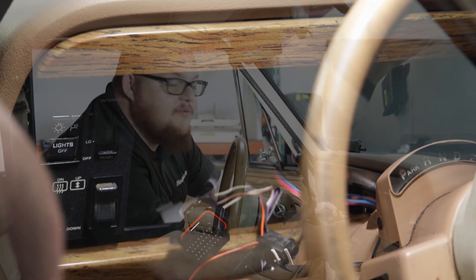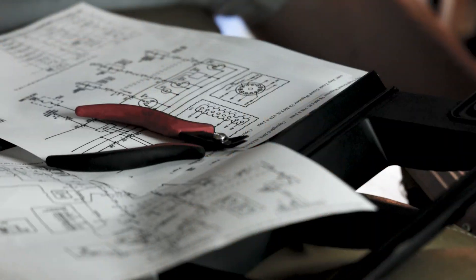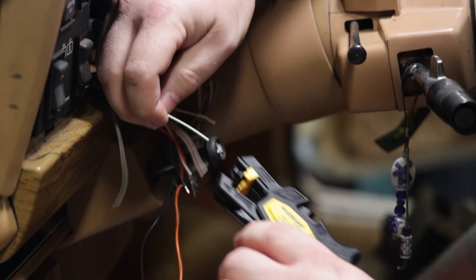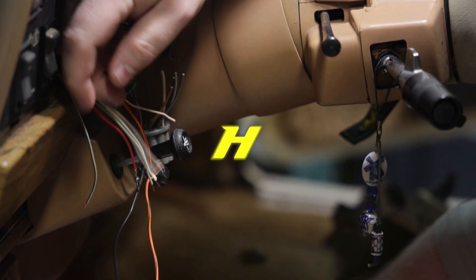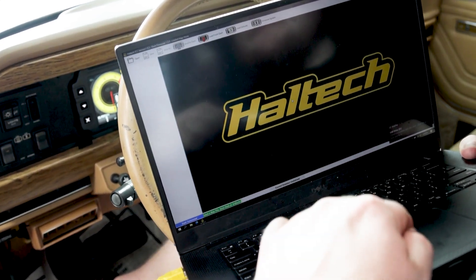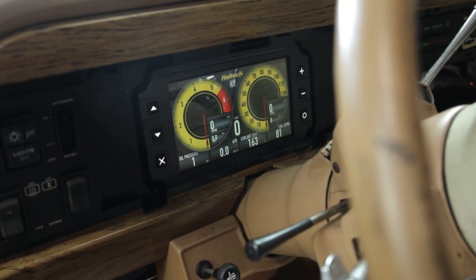We've pulled our in-cabin harness up through the dash and removed our factory instrument cluster. It's important to search online and locate a wiring diagram as we have, then get started cutting and crimping. We finished installing our standalone IC7 display, connecting our 34-pin connector on the rear of the device as well as our comms port. The comms port includes a USB adapter that we've run to our glove box, meaning whenever we need to update firmware or make a gauge setting change, we can do so with a quick, easy connection to our laptop. We used a universal molded panel that Haltech sells for the IC7 display, trimmed down the sides and bottom, and fitted our screen where the stock cluster went — resulting in a nice clean factory-appearing installation.